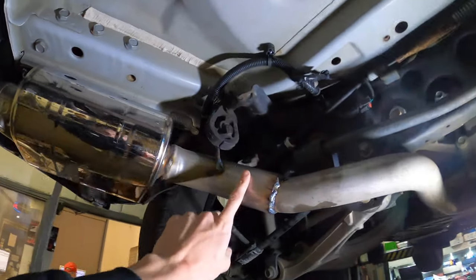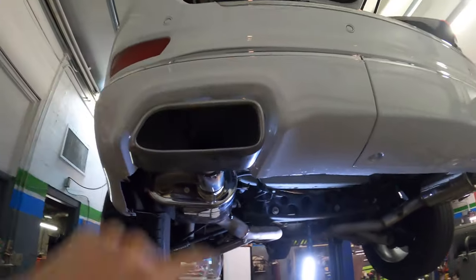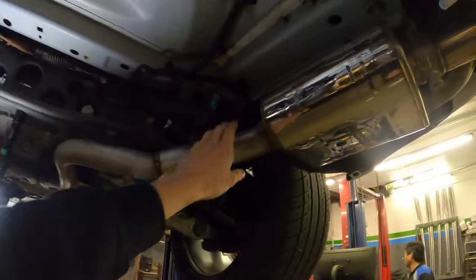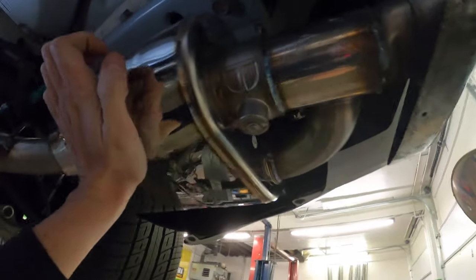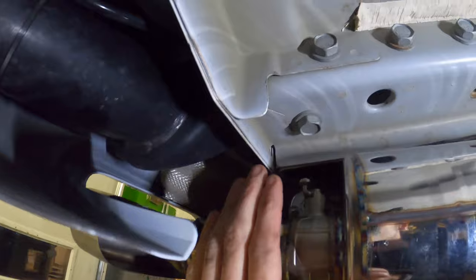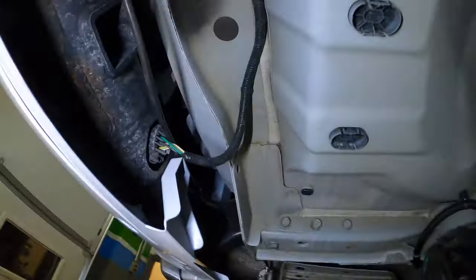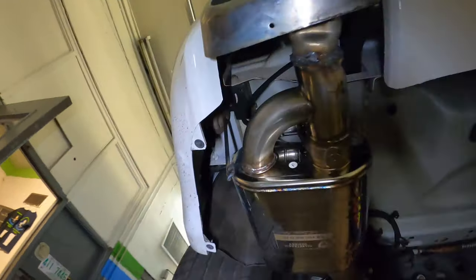The guys did a fabulous job — we increased the pipe to two and a half inch into the muffler and then out to the OEM tips. We decided to keep the OEM tips because they match the bumper really well. I'm going to connect up the vacuum lines right now. Install was super easy and super simple, with some flex in the line so the system can move as the car moves around. We've got our T-splitter going to the driver's side muffler and the same setup on the passenger side. Everything is wired up and zip tied in, and the line runs back up into the car.